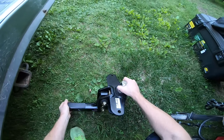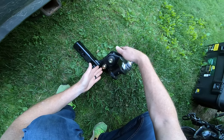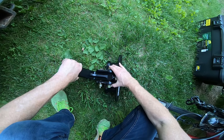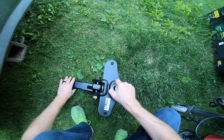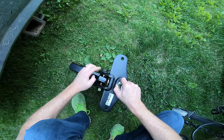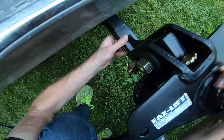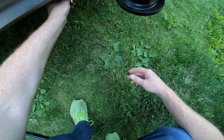I put in the two giant bolts. This brace is set to its highest lift setting, which is what this van needs because it's so low and this hitch is so high. These are conical washers, apparently necessary for this position at the top — at least that's what the instructions said. This is adjustable and apparently allows you to set the angle of the hitch itself. I'm going to slide this in here and use this pin — I have a locking pin but for now I'm going to use the one they provided.